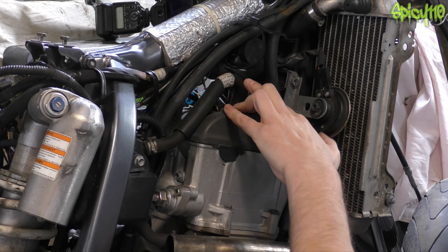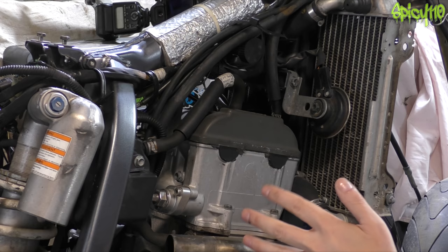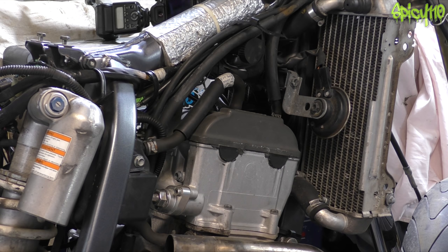I've done the first one to give you an idea of what I'm doing. The breather that comes off the top of the engine - I've labeled it 'top engine breather to catch can, R' - so I know it came from the right hand side, I know where it started and where it's going. This is a very simple bike so I don't need to do it for something this simple, but it means in the future if I do anything more complicated I'm more practiced at doing it.